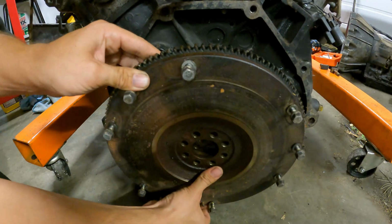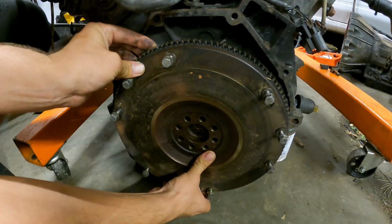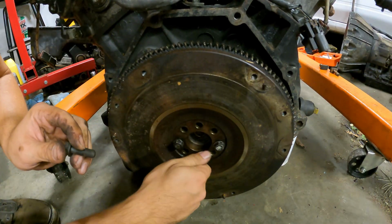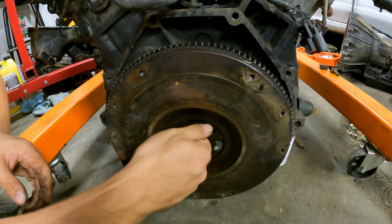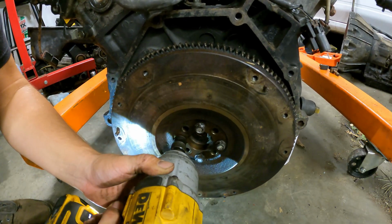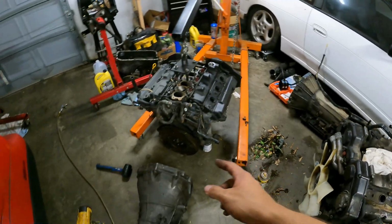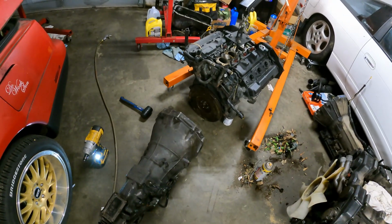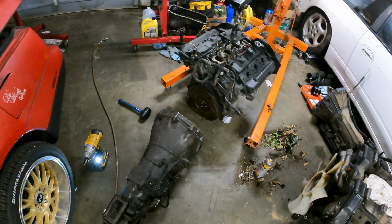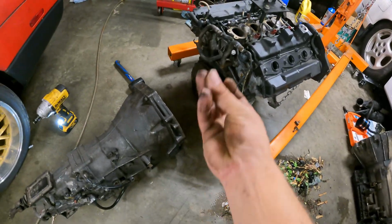We're definitely going to take the pressure plate bolts out. Those things will probably fall off if I had to guess. We're only going to use 4 bolts because, let's be real, it's not like it's driving. Snug them up and that'll be all we need. That's not going nowhere. Let's just take the extra little bit of time, move this transmission on. I have no idea if this is going to fight me. Let's get the starter hooked up and fire this thing up.